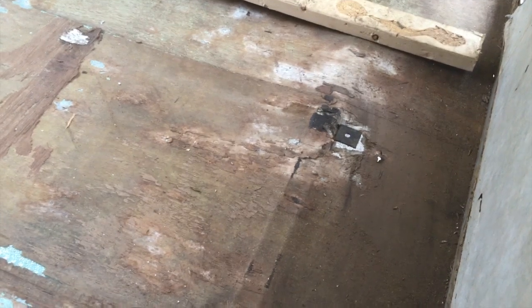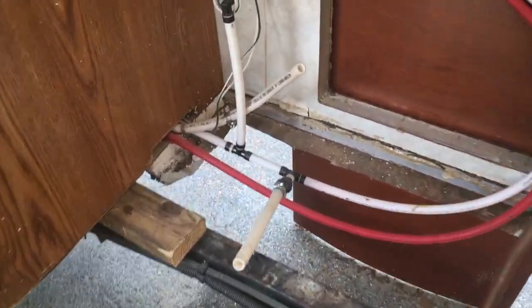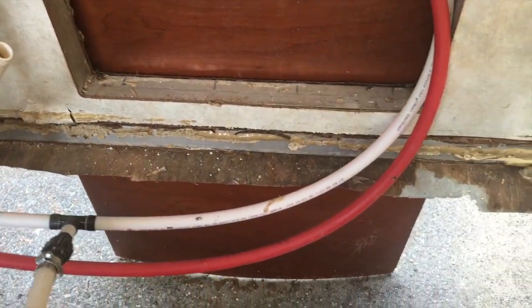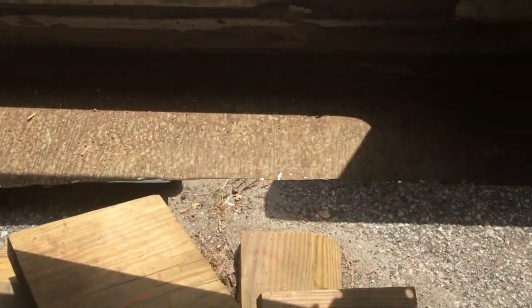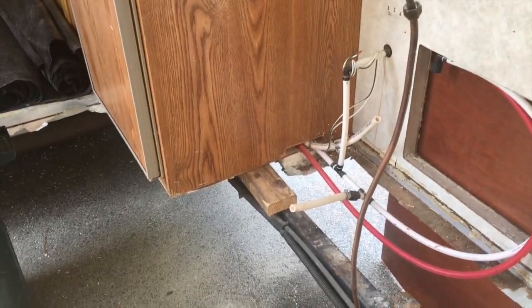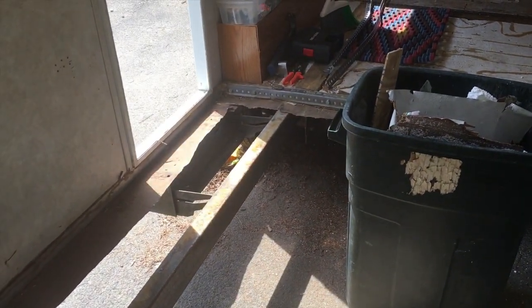Sooner than I wanted, but this is the end of day six. I trimmed that aluminum — still some crappy spots — but I've got myself a little flange for the new underlayment to rest on. It'll go across the chassis rails. Then my half-inch plywood treated on top of that, so I'll get a nice solid floor. It's quite a mess right now but it'll get better — that's what I keep telling myself.